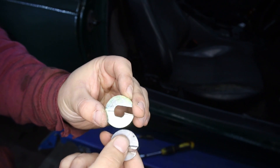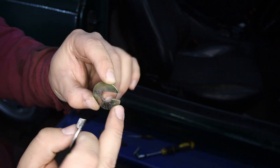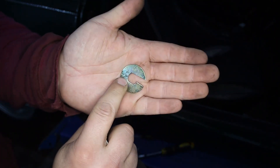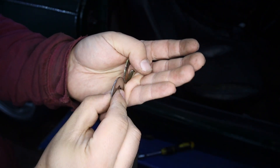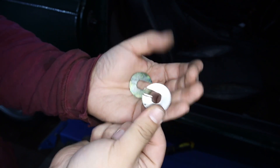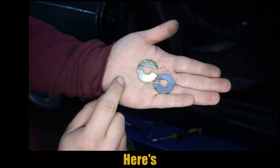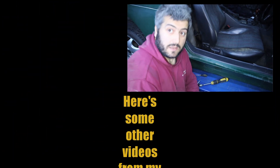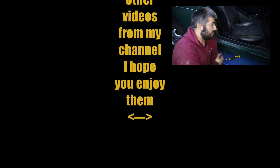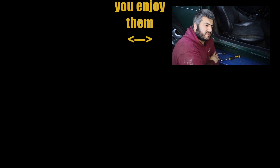Here's a picture of the original factory part with a tiny lip — you can see the crack and how thin it is — and then the washer I replaced it with, which is a tiny bit thicker with a bigger lip. So that's it for today's video. I hope that was helpful to someone. I have my seat working again, which is nice because I was actually driving almost with my face on the steering wheel before I got this fixed. Thank you for watching and I'll see you in the next video.